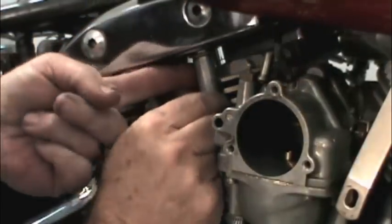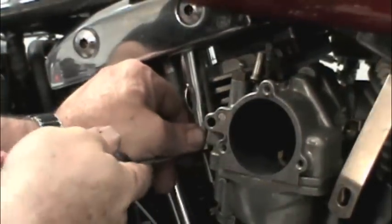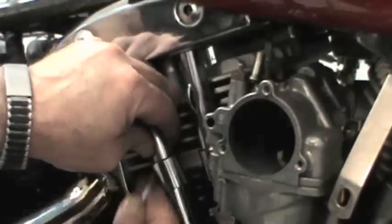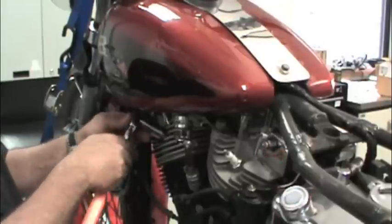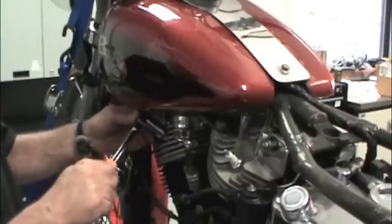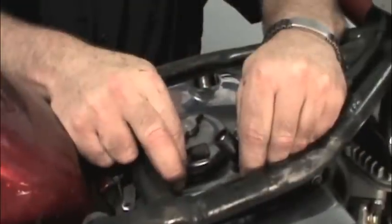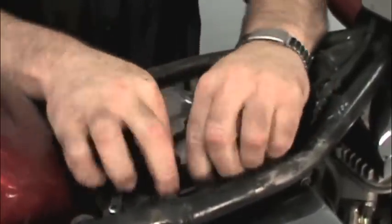All that's left is to close up the pushrod covers and reinstall the cover keepers. Put the spark plugs back in and reconnect the battery. It's also a good time to clean up the bike. If you let oil or fingerprints burn onto your pipes, it's not going to be easy to get them off.